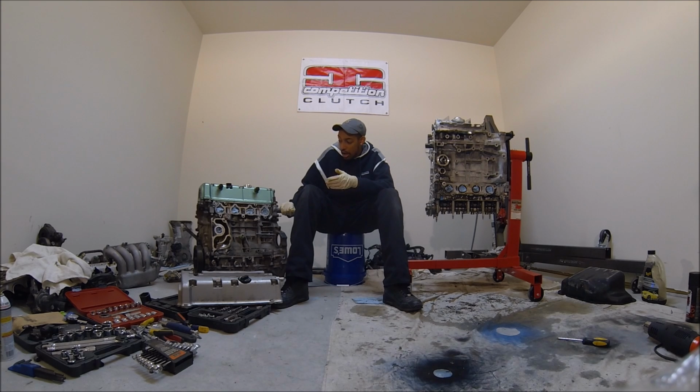Me personally, if you daily drive the car, I would probably just change the bolt-ons because you keep the reliability. You don't want to break open these motors because the reliability drops extremely quick. Like most guys that run cams in these, they're eating up timing chain tensioners. And too, if your timing chain tensioner fails, the motor's kind of toast. For me, if I was daily driving and I knew I needed the car, toasting one of these isn't just, oh, here's $2,000, I'll buy another one tomorrow.